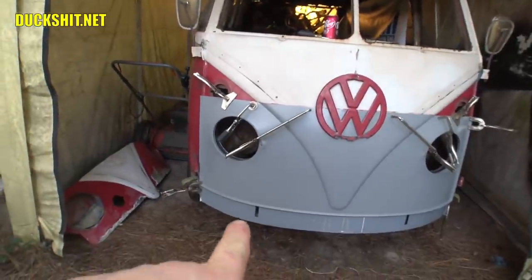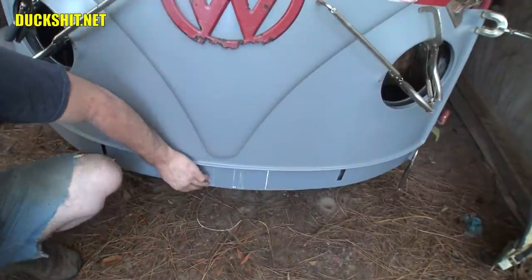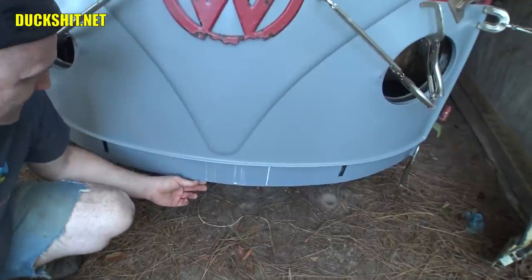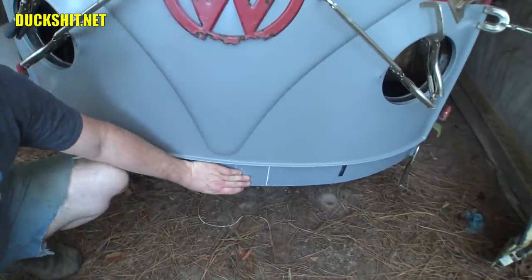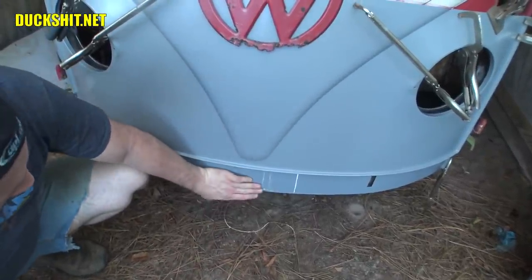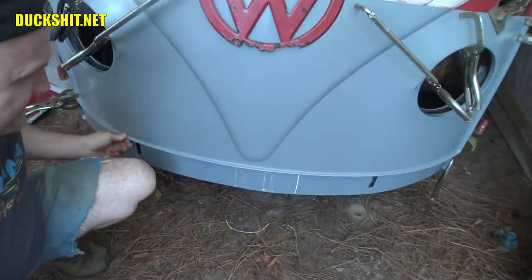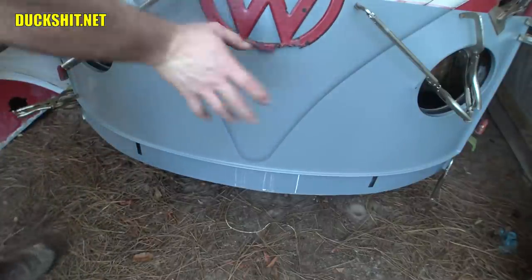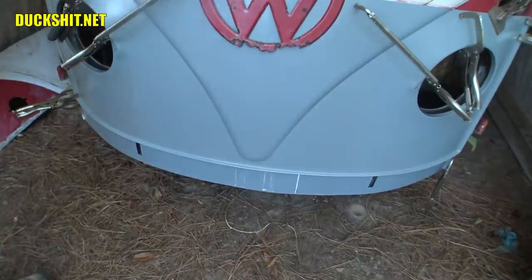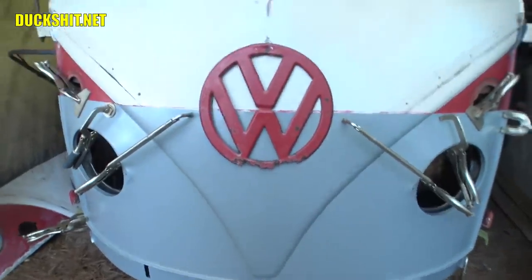I'm looking into bumper bracket holes. It looks like they line up. Even the bottoms of these panels here are really close. I'd say within about a 16th of an inch, they're almost even. And I kind of fudged it, because the panel that's behind this, I just guessed where it was supposed to go. I don't really know. I've never worked on one of these before. So I just kind of winged it, and it looks like I nailed it. This should be good. I trust this. Okay, well, let's go ahead and get these things drilled, install some clecos in there, and try to solidify this front end, as I think we're going to somewhat finalize its position as to where you see it.